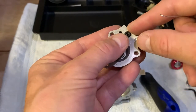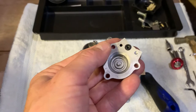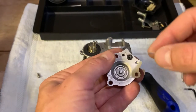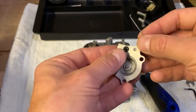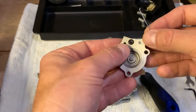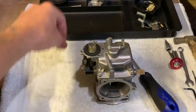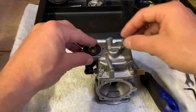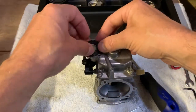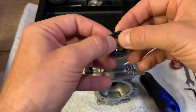If you haven't taken apart your carburetor for many, many years, you might as well buy a rebuild kit — you'll have all the o-rings and gaskets in there. If you've recently cleaned your carb in the last two years, it's probably not necessary. You got your spring and your diaphragm here — again, check it for cracks, tears, holes.